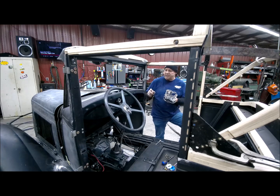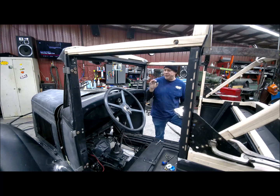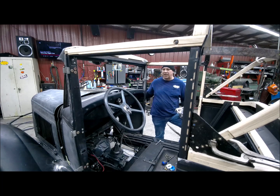While I'm doing it, the gas tank needs a liner in it. So before I put this in, I'm going to go ahead and pull the gas tank and put the liner in the tank, and I'll actually drive it around and run it off the fuel of the tank, and that's going to let me test the fuel gauge to make sure it works and seals off good, and then all the lines that go down and the filters to that new carburetor, make sure all that's working good. And then if I have to make some repairs, I can do it now instead of doing it later.